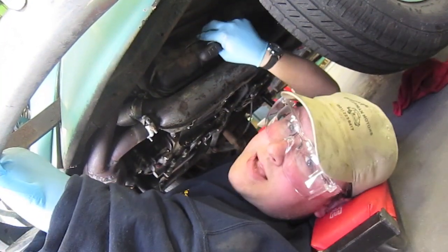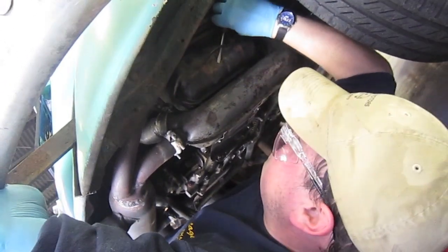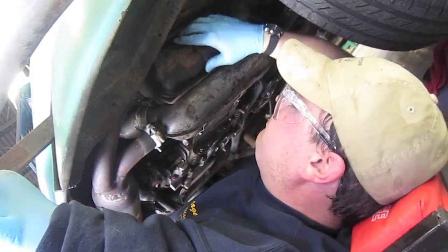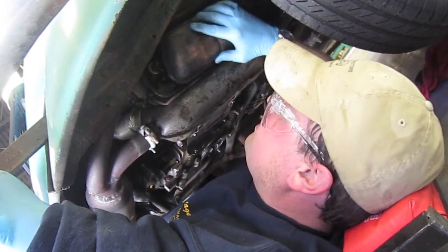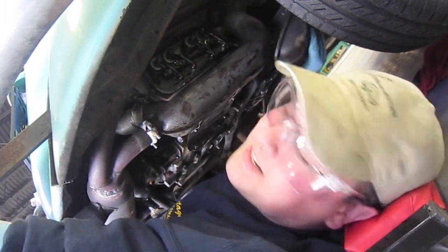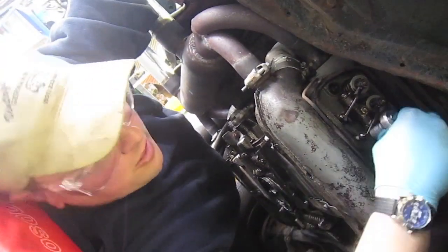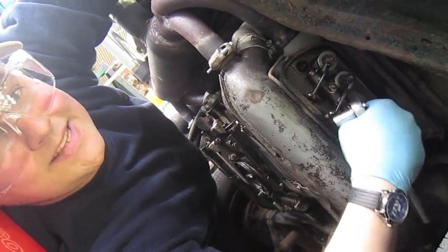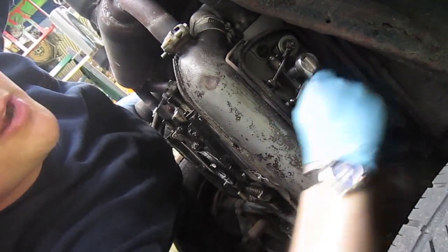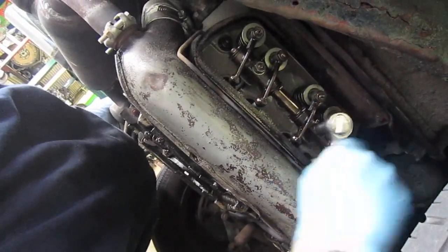The first thing I'm going to do is pull off the passenger-side valve cover. Just slip your screwdriver under this wire right here and flip it on down. She might fight you a little, but not terribly hard. She might drip a little too — so if you're doing this in the living room, your wife or mom is going to be ticked. Next, I'm going to take off the rocker arm assembly. There are four head studs just underneath that — this one's 13mm, so that's the socket you're going to need.